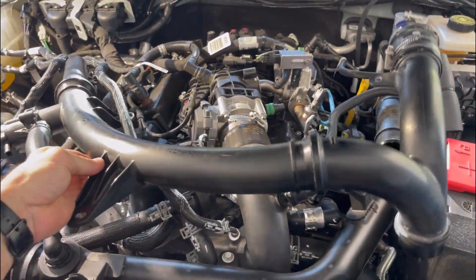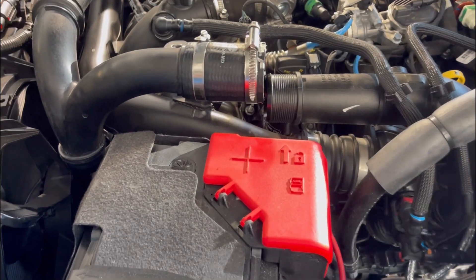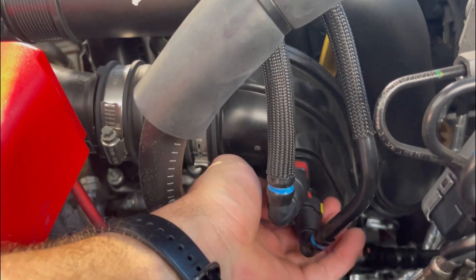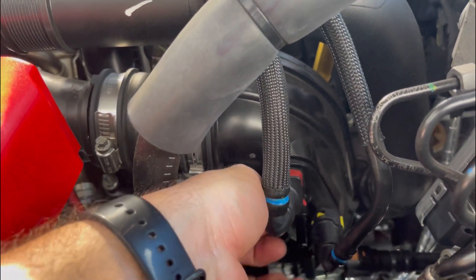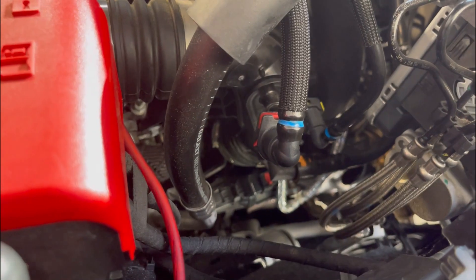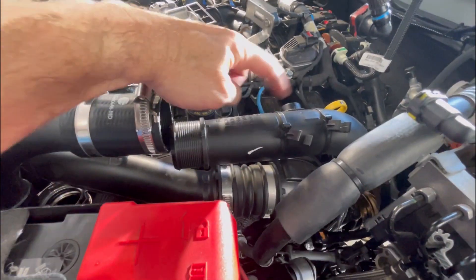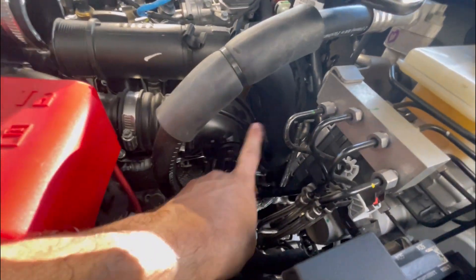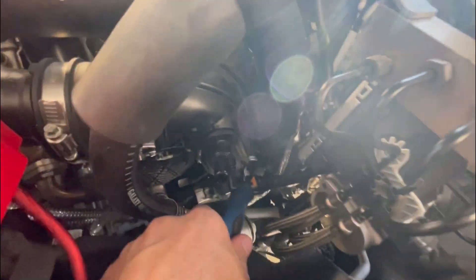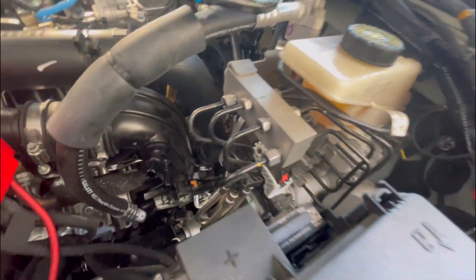Now this whole piece is free to swing around. We're over on the side with the battery. Come down to the intake tube and you've got two lines coming here — just press in on the yellow piece and pull these off, and you've got another red one to pull off as well. The one with the red tab was a little tricky; there's a white button on the bottom. We're going to remove this pipe, which goes way down here — there's a screw on this side that you can access through the wheel well.